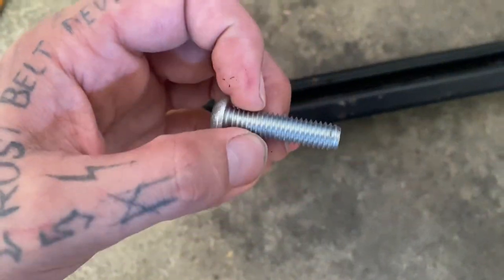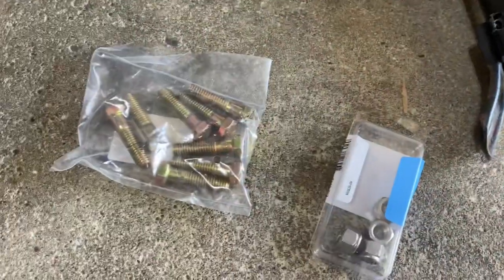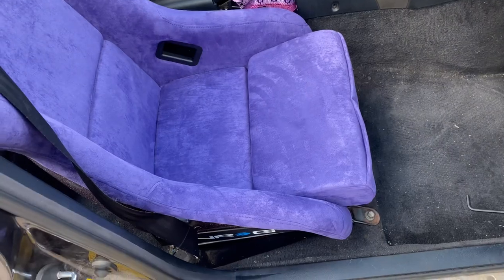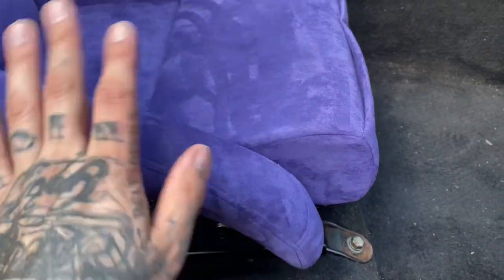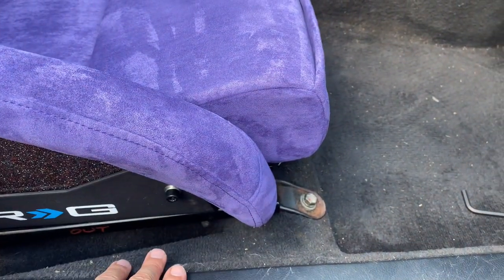All right, so once you have your seat with only one bolt in the front on each side, you bolt down the whole seat rail to get it where it needs to be, and once you have that bolted down and everything clears, snug your front bolts on both sides. Tighten them as tight as you can get them, because that's where they need to stay. Then remove the seat rail bolts one last time. Take your seat, flip it over and drill the holes for the final back bolts, which you should still be able to utilize one of the holes on the factory seat rail. So drill just one small last hole and then throw it back in and bolt it down for good.